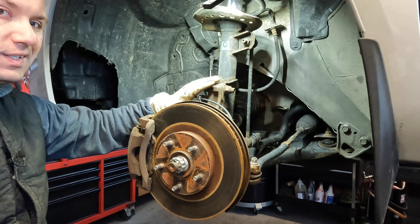Before we remove those bolts, what I like to do is get rid of this cover — it's always in the way. I'm going to use my pocket knife to remove the clips by popping out the center. There should be several of these. Now this car is older, and it looks like someone chewed through the liner at some point, so we're going to be missing a few. Some might break — I'm not too worried because I keep a lot of these clips on hand. You can go online and buy a 200-piece kit for 20 bucks or so. Once you remove the clips, we're going to slide our cover off.